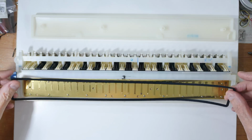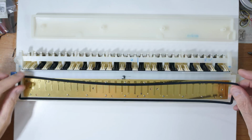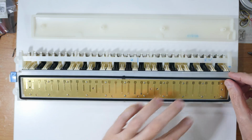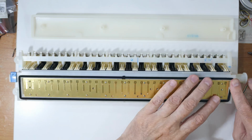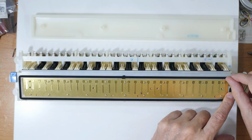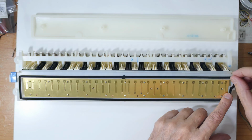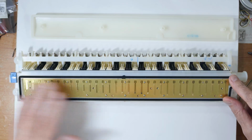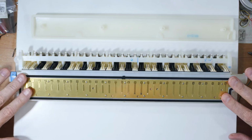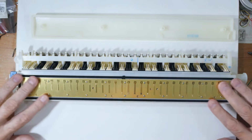As we begin to reassemble it, the first thing we need to do is assemble the airbox. And we put the gasket in here. And again, we want to be really careful, as we said earlier, about getting this thing in here real nicely, because I tried to find a whole gasket set for these and absolutely had no luck. So you want to make sure that gasket is laying in the groove very nicely, and it's not sticking out somewhere like it is right there. Make sure it's in there. Okay, and that feels good.